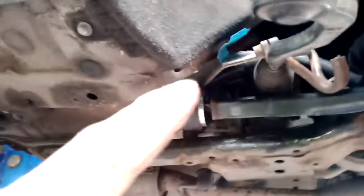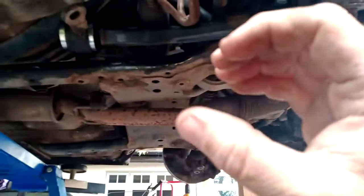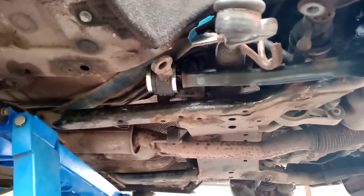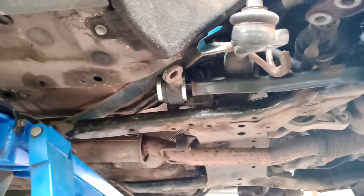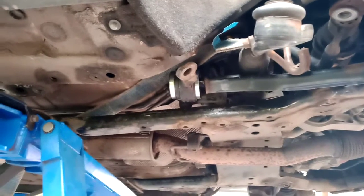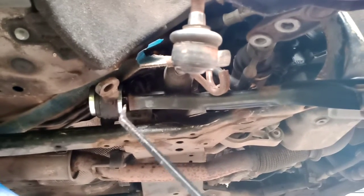What we did was use a cup assembly kit you can buy off eBay — it's actually for a hydraulic press but it's a series of different size cups with large bolts about the size of your finger. By using the cup assemblies, you can press the bush out. I'm talking to you like you know what you're doing — if you don't know what I'm on about at this level then this job is probably way out your remit. We used a couple of cups and a big threaded bar from a proper kit, managed to pull the bushes out and press them back in using the same method. The hard thing was getting the pin back into the new bush — absolutely solid — so use plenty of rubber grease on it.